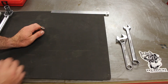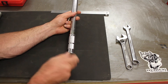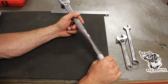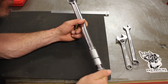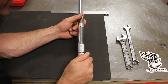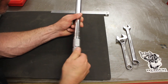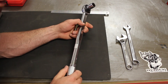To do that, there's a tool called a torque wrench, which is used for that job. You can adjust on this scale here what torque you wish to achieve at the socket end, and once you pull on it, it will give you a loud click indication to tell you that you've reached the desired torque. These are generally considered a precision instrument, so you don't want to be dropping them or using them as hammers. In a quality-approved organization, these would be calibrated maybe every six months or three months, whatever is appropriate. You simply adjust this dial to the torque setting you wish, lock it down, and then use it like a normal socket wrench.